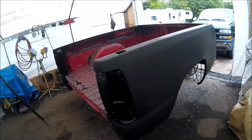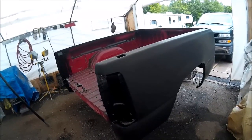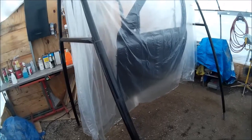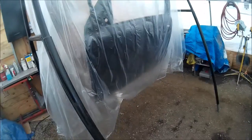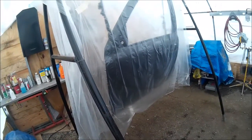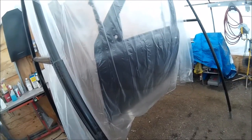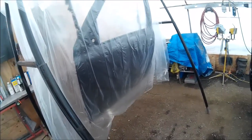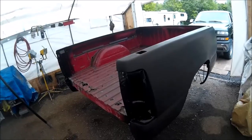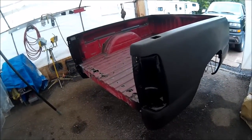We're in the process of checking how to mix and how to spray in that kind of humidity. This is the door — we just got it covered up to keep dust off as I do body work. That's all prepped and ready to go. When we spray the box, we'll be spraying this independently — we're not going to spray them at the same time, because it's a lacquer clear that dries in the air relatively quickly and I don't want overspray.